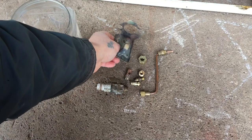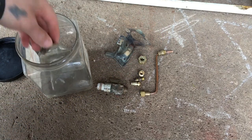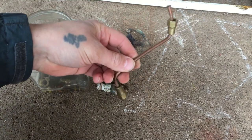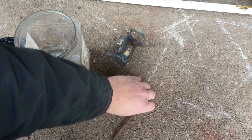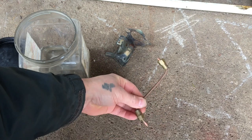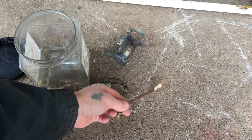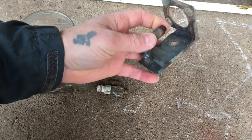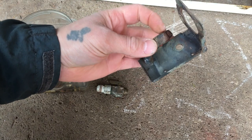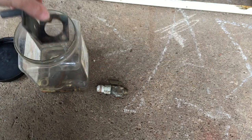Here are all the parts we removed. I'm going to soak them in some paint thinner. For this main gas line, tap it out a bit — just bang it on the ground to get out any deposits inside. Then throw the burner in the paint thinner too. After soaking I'll take them to the wire wheel and clean them up a bit.